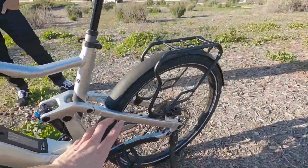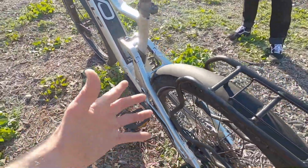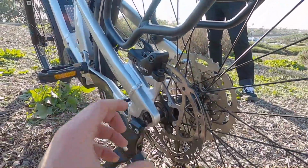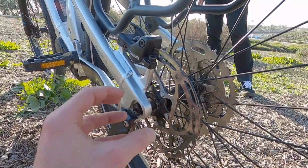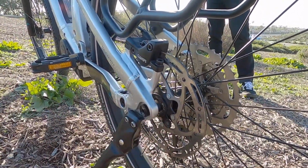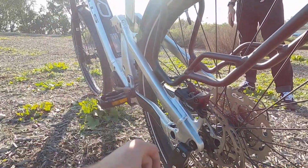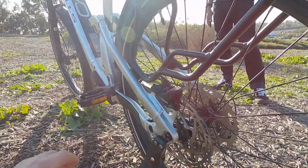And it's measuring your rear wheel speed, pedal cadence, and pedal torque over 1,000 times per second with shift detection. And the magnet here for the rear wheel speed, it's right here, kind of on the hub or near the disc brake rotor, and it's much more protected than the old spoke magnets and the little plastic sensor thing. They could get bumped out of position, get dirty.